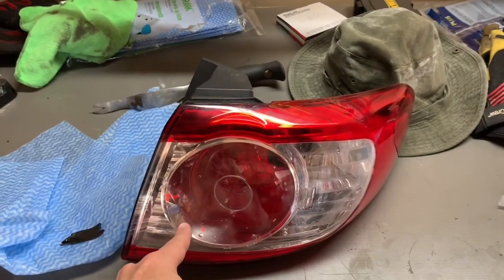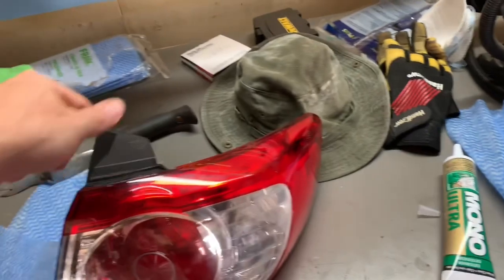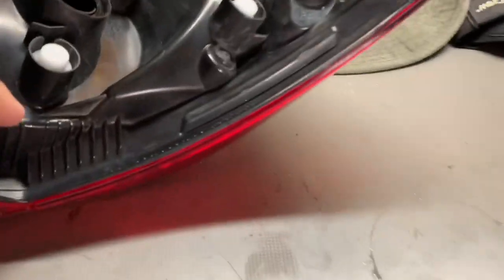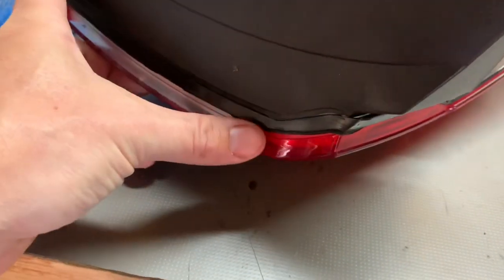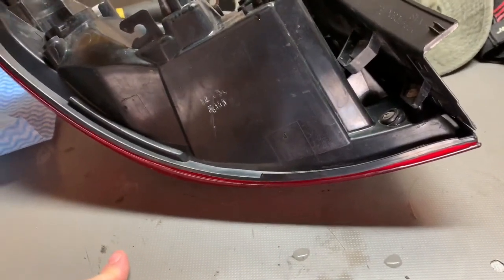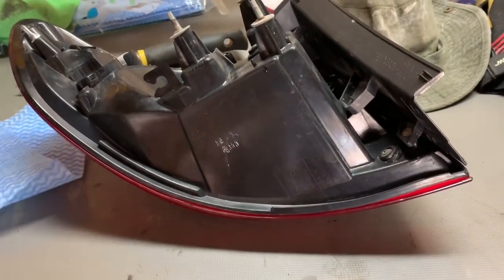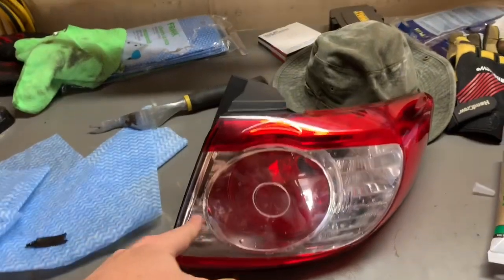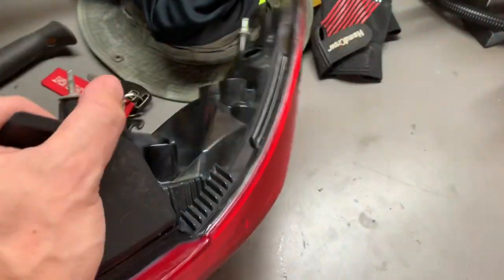This is the right-hand, passenger side of the assembly. We know the top edge is where the water is most likely getting in, so we're going to take our exterior clear silicone and run a bead all the way along. You could also go all the way around the assembly since water could be coming in through the sides. You don't strictly need a bead on the bottom — if water got in there it would have a place to come out — but to keep the unit 100% sealed and prevent any moisture from the air getting inside, you can run the bead around the whole assembly.